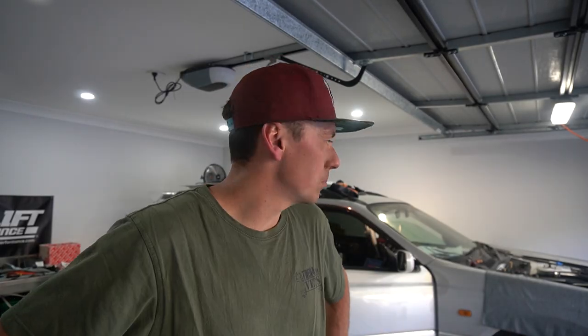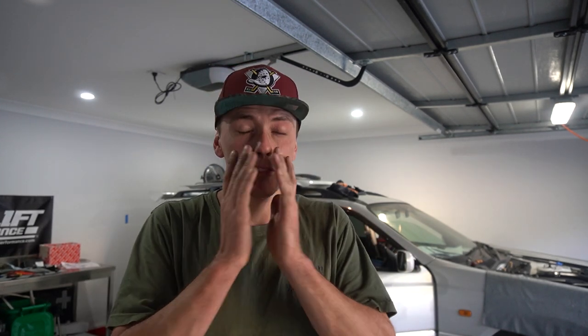Another new day, because after what you just saw, I spent a whole day trying to just sort out the software. Not that it was hard, I just have never ever done it before. Case in point, I spent like 4 hours with the car coughing and spluttering and just dumping fuel and just hating life because my idle control was still set to whatever the 33 GTR base map comes with. I didn't have it set to drive by wire. Turn it to drive by wire, kicks over. So, prepare yourselves.